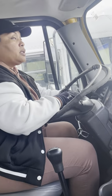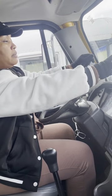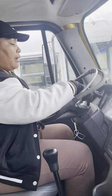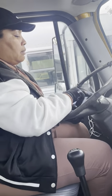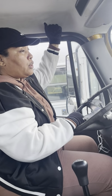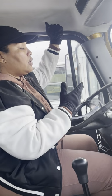This switch up turns on my five clearance lights. It turns on my low beams. Yes. So with this switch up, low beams, high beams, and five clearance lights are on. Now I'm going to turn them off. My city horn's working. Up here is going to be your freeway horn in the truck that you'll test in. My freeway horn is working.